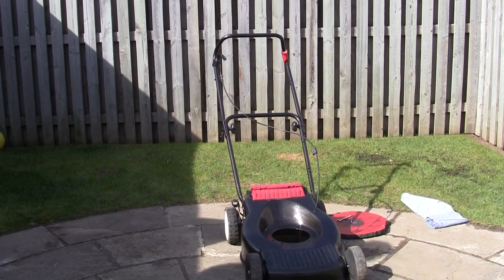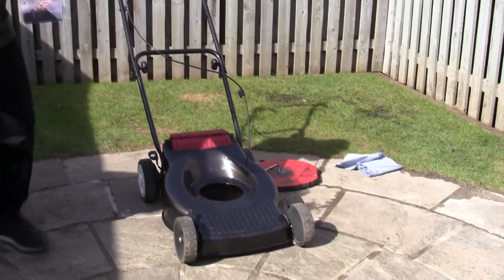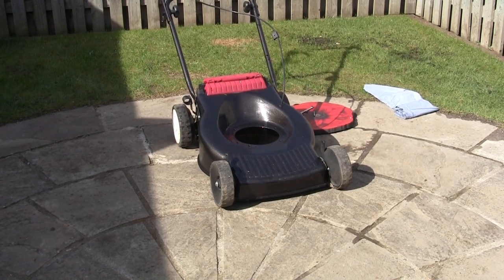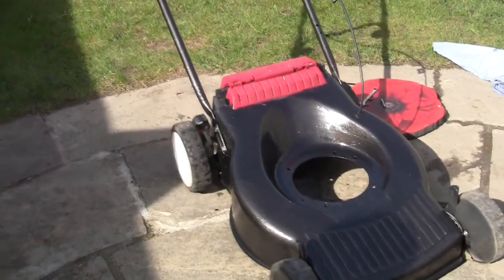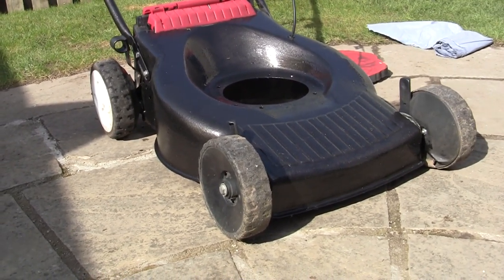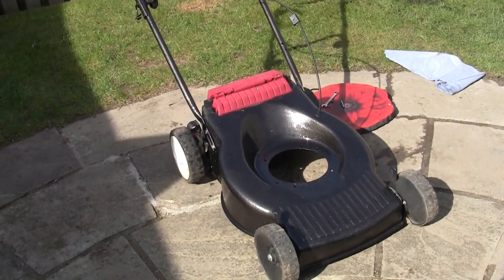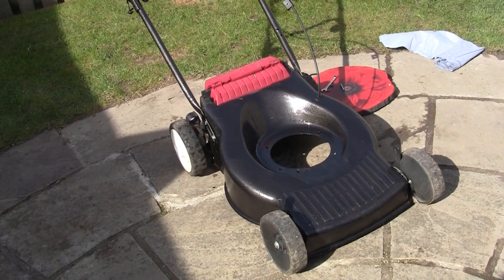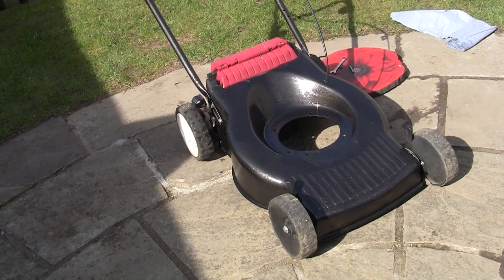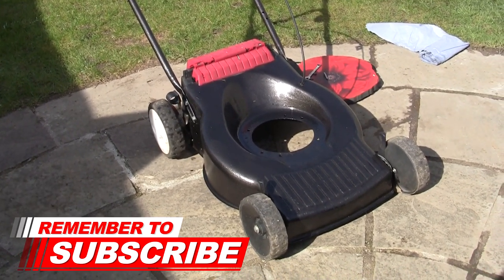You can probably see it's just a quick going-over with the paintbrush, but if you were to sell that with the engine back on and everything cleaned up, you can see what a difference it's made - and it's only cost a couple of pounds in paint. It's not going to win any awards for paintwork but it's tidy and it's protected - that's all we need. So I'll wait till that dries, put the sticker back on, and bolt this engine back on. To summarise: if you're doing this with the engine on, tip it with the carburetor side up, don't tip it right over, remove the spark plug lead, clean the underside with a wire brush or pressure washer, and paint it with some Hammerite paint. I'll leave a link to the paint in the description. Thanks for watching, see you next time.